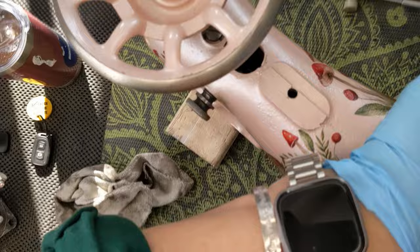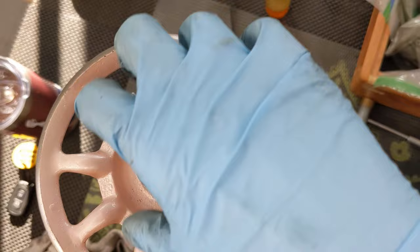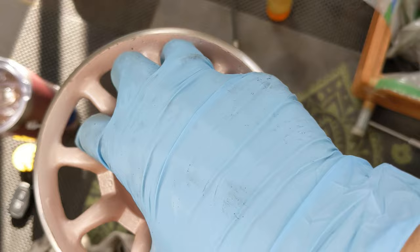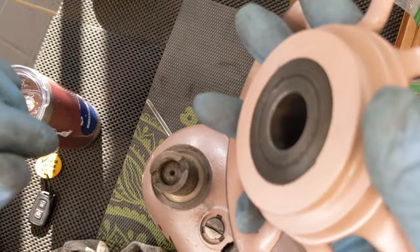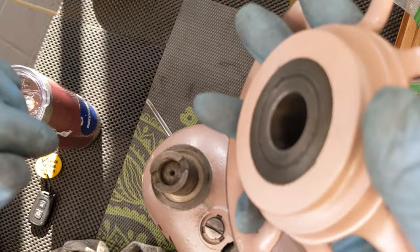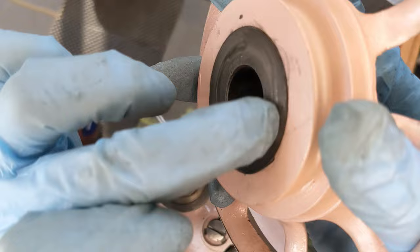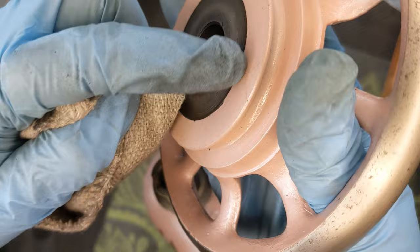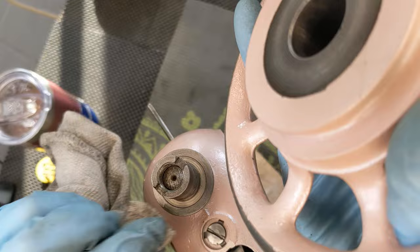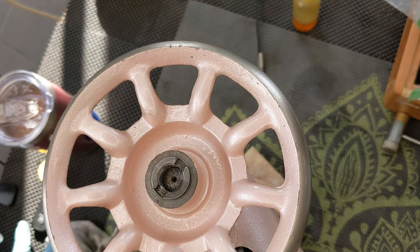I want to show you something else with the wheel still off. When you disengage the clutch — like when you're going to wind a bobbin — you want to be able to spin the wheel without the needle moving. If that's not happening, there might be something dirty on this part of the bushing or on this part. Mine actually had a little bit of paint on there that I had not cleaned off. I came back in and cleaned off that area and put a couple drops of oil on there, and now that should move freely. Let me go ahead and put the little knob back on.